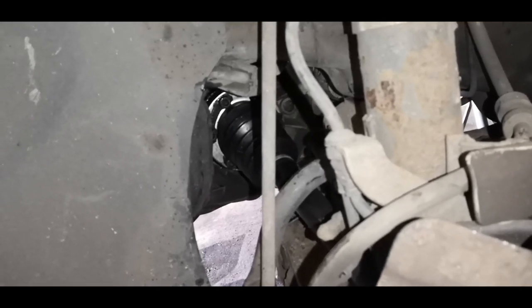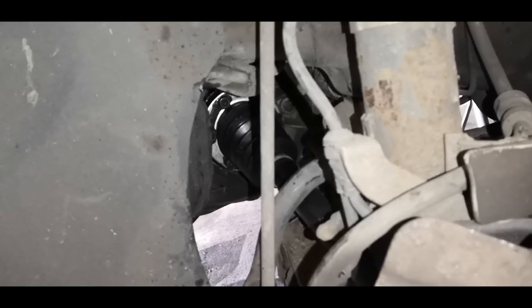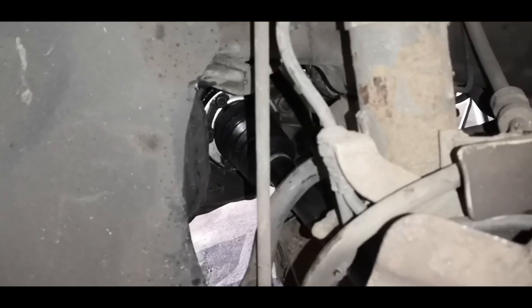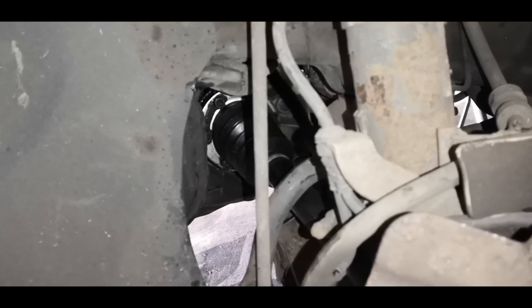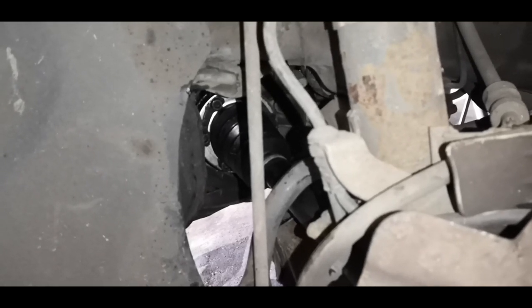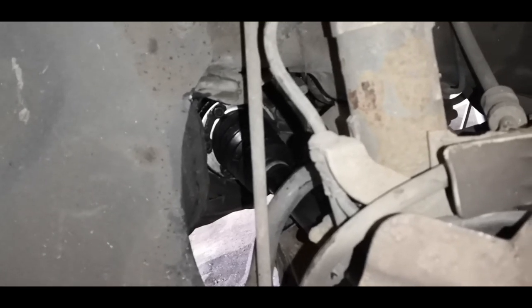Essentially, the most important thing with these is you have to tighten them down gently, and then go back around and tighten them down all the way. Otherwise, they don't seat evenly, kind of like doing a clutch or a flywheel. So that's what I've done here. I've tightened them down twice and I went over them again with my impact just to make sure they were tight, especially considering that on this car these came loose before, so I'm especially suspicious.